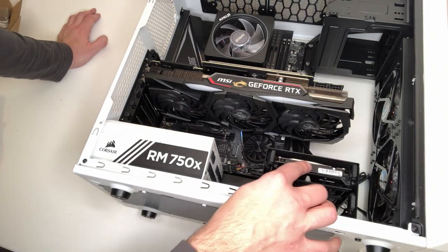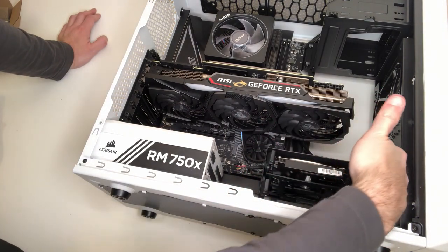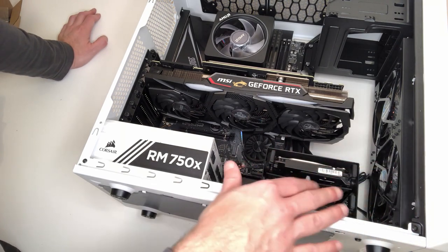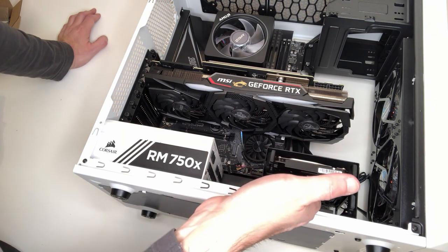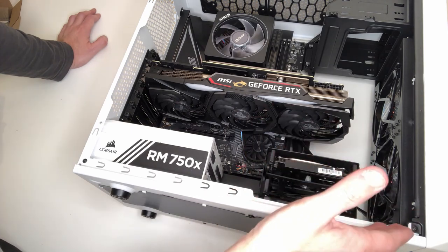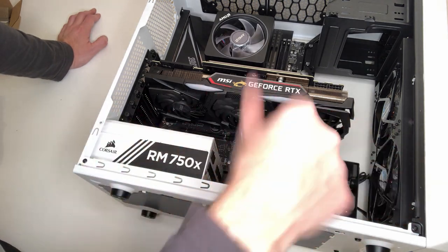The reason I'm putting the bigger hard drive on the top is because the fan is right in front of it, so it will keep it a bit cooler. And also the heat: if I put the non-SSD on the bottom, the heat will go up to the SSD one, so it's better having the SSD on its own, with a lot of air around.